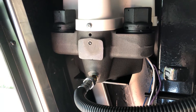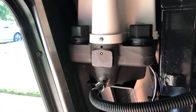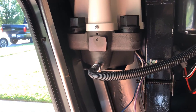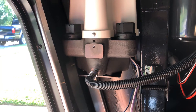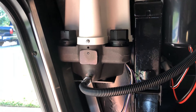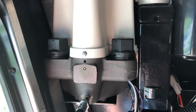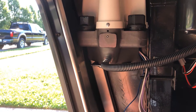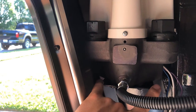Starting with what I got done yesterday in about a half day: I focused on where I wanted the pump to be. I wanted it on the right-hand side of the camper because the left side is weighed down with the kitchen and bathrooms, so there's a general imbalance. I also wanted the brake lines running down that side, and I wanted it in the front compartment where the batteries are, mounted to a metal crossbar.